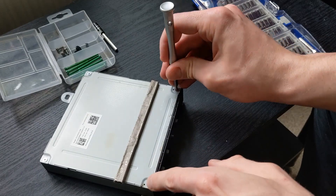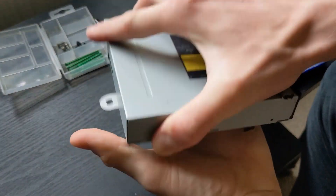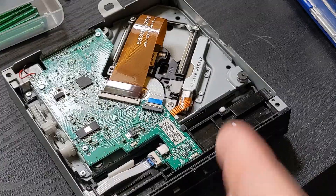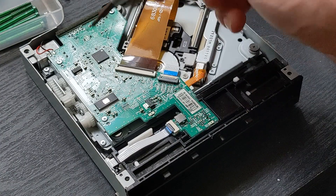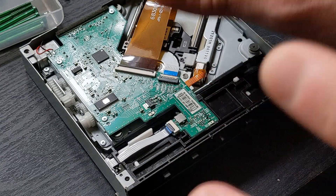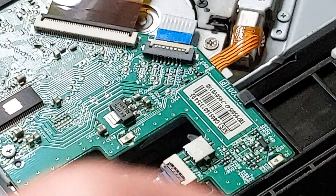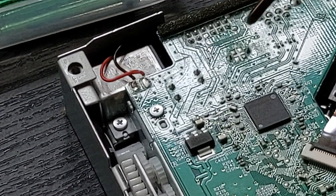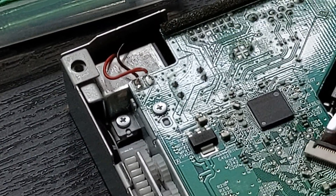Take out the screws on the top, then turn it upside down and give it a little shake to get that off. Now this is where the soldering comes in when you watch other videos. When replacing the disk drive, everything else is fine except this green PCB — this is the logic board. This is hard-coded to the Xbox itself, so if you replace the whole thing as a set, your new disk drive isn't going to work. If you zoom in, you can see the motor is soldered onto the board here. They say to desolder it, put this board in the new disk drive, and then solder it back on.